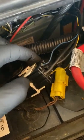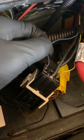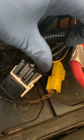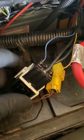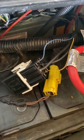What's going on is this blue wire goes to the transmission control module, and that's supposed to have 12 volts to it. This yellow wire actually goes to the engine control module, and that gets grounded so the relay turns on. So the transmission sends 12 volts, the engine controller grounds it, and the relay turns on causing the vehicle to be able to start.